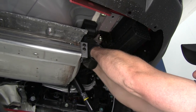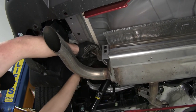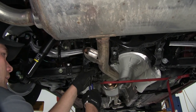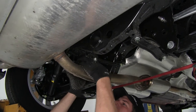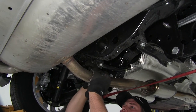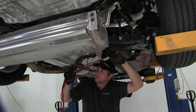Just squeeze and push those off of there. If you have an exhaust hanger removal tool it can make the job a whole lot easier, but if not a pry bar or screwdriver can help. You can rotate those out of the way — it'll make it easier to get our exhaust back up into place later. Here on the middle one it actually looks like it's easier to just take the top two off rather than the bottom one. Now we can just hit the release on our strap and allow that to come down slightly. That should give us more than enough room to work.